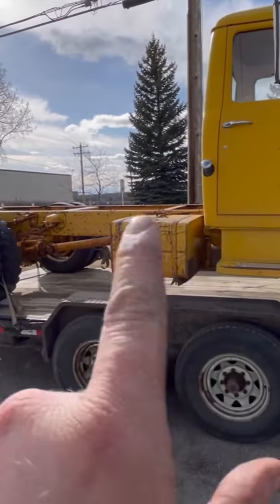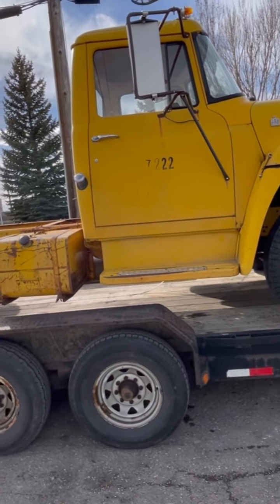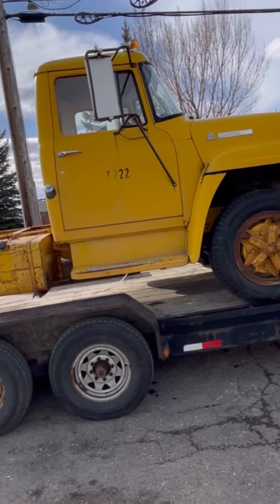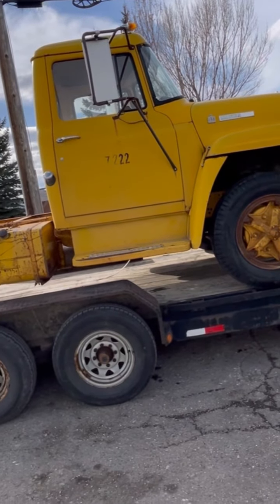To start with we're going to do it on a budget — I'm not sure exactly what the budget is going to be, either ten, twelve, or fifteen thousand dollars. I've got to sit down and figure out some numbers, and also consider a bunch of stuff I already have that I'm going to put into it. I think we're going to use the original frame. I'm going to be changing the axles because I want disc brakes with big ten-bolts so we can put 22.5s and have the 22.5s cut for automotive tires. To start with it's going to get a 12-valve with an NV5600, and then I'm going to put a transfer case behind it — the transmission I have is out of a four-wheel drive truck.